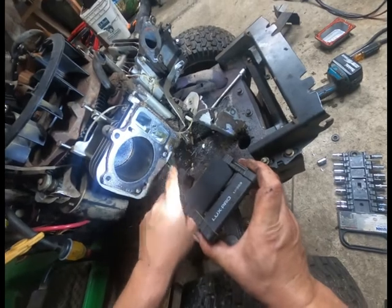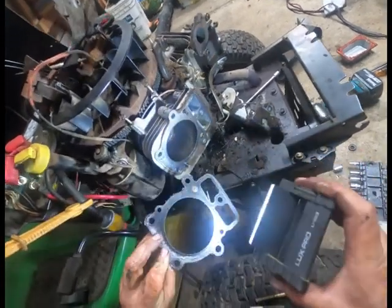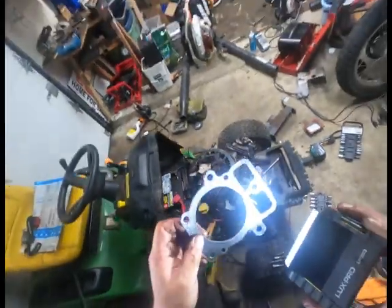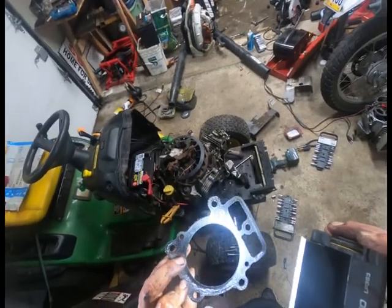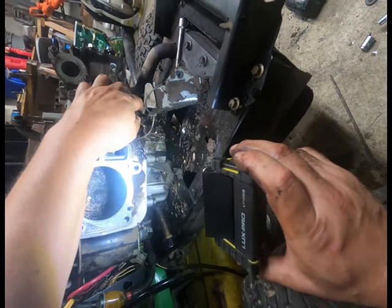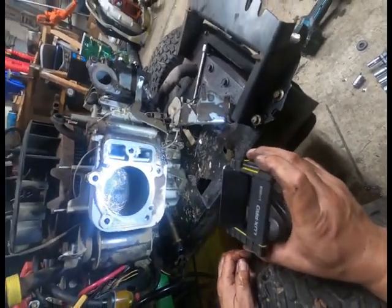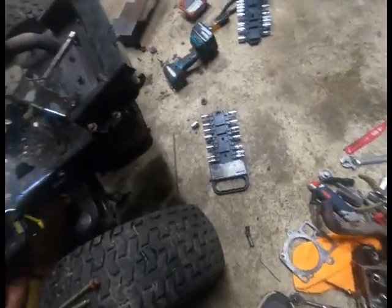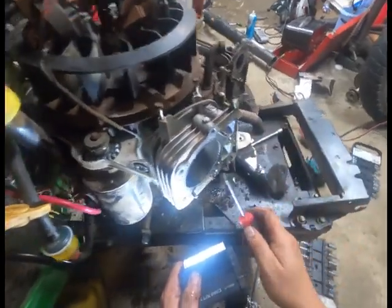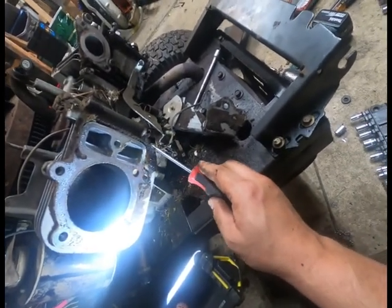You can see, push down through here, definitely weeping at the bottom, blowing through the top. I don't see a clear passage though, like you normally see. But you can see, it may actually be the governor seal. Based on my observations here, maybe over in here, it almost looked like there were two gaskets on there. Usually you see a clear passage, but this could be.